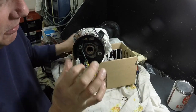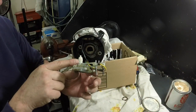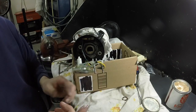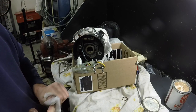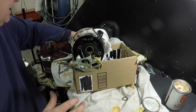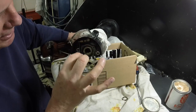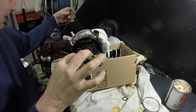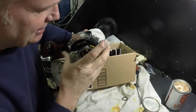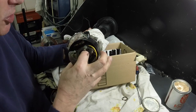I'm going to finish and I did tape a little bit of this wiring where it goes through so anything that might rub on it doesn't rub the insulation off. I want to put some white grease on this right here - this is where the turn signal stock screws into - I want that not to bind up in there. I want to put that wire for the light back down in there - there's a little channel it fits right down into. I'll pull that as I pull this back into place so it doesn't get pinched in there and cause a future short.